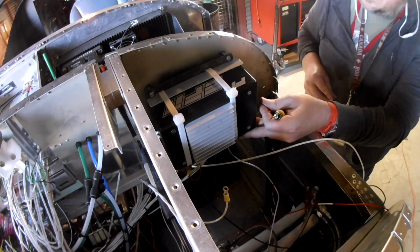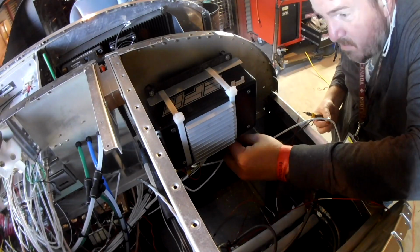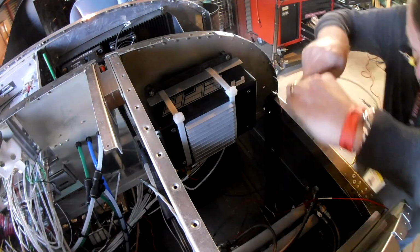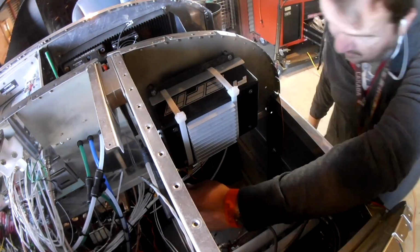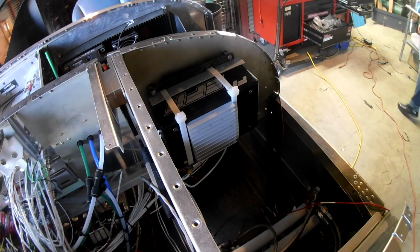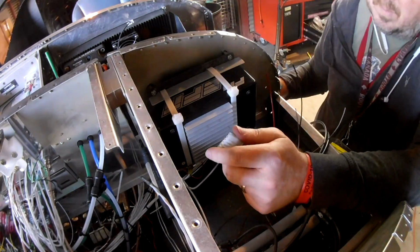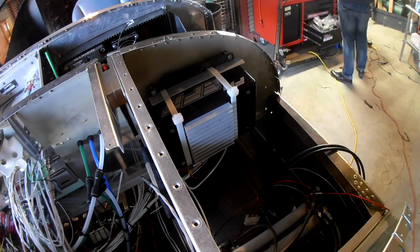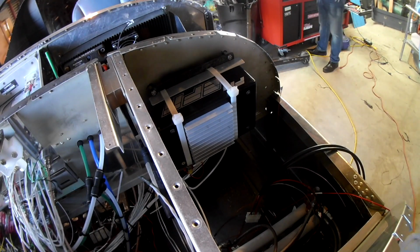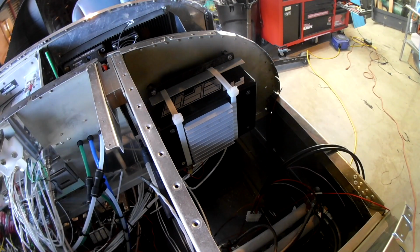As I'd mentioned before, this thing has a lot of functionality. It's really freaking cool. But if you don't need any of that functionality, like fuel pump selection, starter battery selection, all of that, you can always just hook up whatever you want. So right now I've got it hooked in. The power's coming in from that 12-volt power supply you saw me messing with in the last video. So that'll be the quote-unquote alternator, because there's no batteries hooked up. And then that feeds both buses.